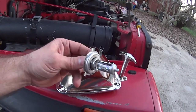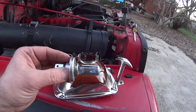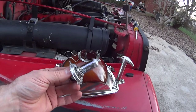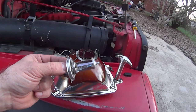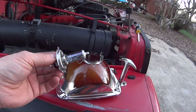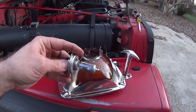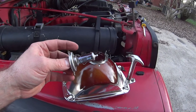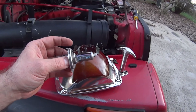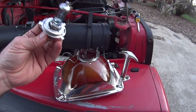Here's the replacement bulb for this lamp. When you buy the Hella kit you get two bulbs and two lamps, but these are not the original bulbs - one of the originals lasted about three or four days. This is actually a Sylvania Silver Star bulb - much better. Also, notice my fingers are way back here - do not touch the glass on these H4 bulbs. The natural oils from your skin will create a hot spot and shorten the bulb's life.